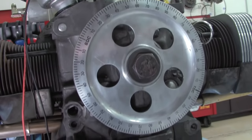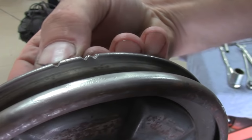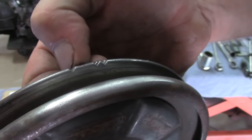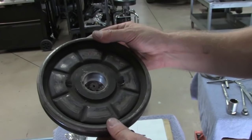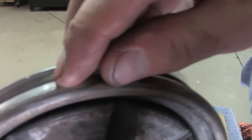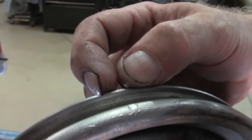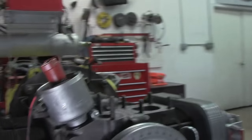We're lucky because we have a pulley here that's got all the timing marks on it, which makes it very simple. If you've got an OEM style pulley, your top dead center mark is going to be this notch — the other two marks are your advanced notches at 7.5 and 10 degrees. You're going to mark that with white out or white paint so it's easy to see, then go 180 degrees off of it for your bottom dead center mark. There's another common style where a big notch on the side of the pulley is your top dead center; go 180 off that for bottom dead center.